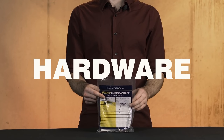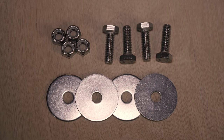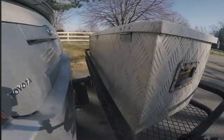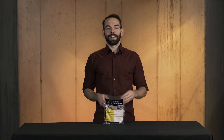As far as hardware, you'll need four 5/16th hex bolts that are one inch long, four 5/16th flat fender washers that are one and a half inches wide each, and four stop nuts. The reason we really want stop nuts is because this contraption is going to be rattling a lot when you're driving, and we don't want these working loose and the box bouncing off and tumbling through highway traffic.